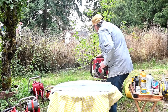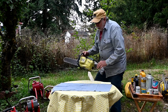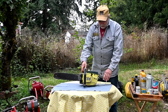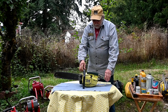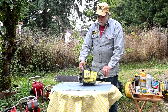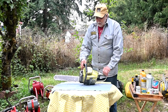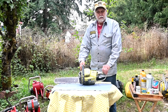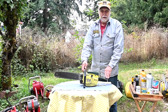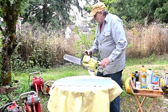This is another little saw I use — a little Pioneer P20. It originally said 16 to 1, and over the production time they went up to 32 to 1. But I always run it at 20 to 1 because it's a hard-working little saw. If you're running in warm weather with a thin oil mix, it smells hot and the performance drops off.